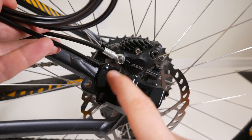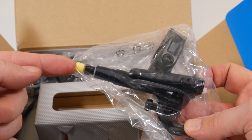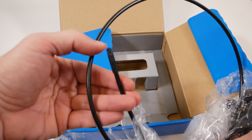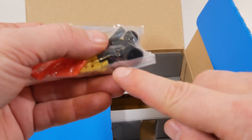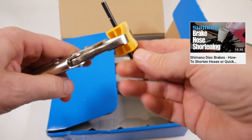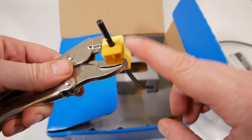However, I much prefer the design of the caliper this time with all those details. In the box you get a user manual that doesn't include much information. The lever is filled with oil and capped with a yellow plug. The olive you need to insert the hose with is behind that nut. You have the caliper and the hose, also capped under a rubber plug. Only with the front brake do you get a bleeding block — that's the insert you'll need to finish the installation. I have a video on my channel on how to shorten hoses. They no longer include the two-piece block Shimano used to include, so try to find one at your local bike shop — you'll need it when pushing the insert into the hose.